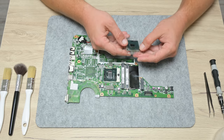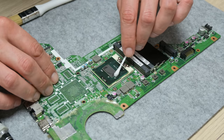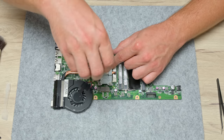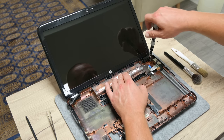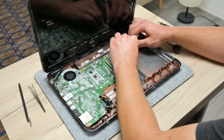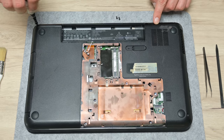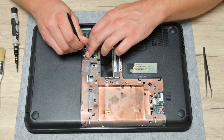Before assembling, I upgrade the CPU first. I clean the new CPU from old thermal paste using a little isopropyl alcohol and brushing. The safe way to clean the CPU is while it's in the socket, because the pins are protected there. The new CPU is an Intel i7-2670QM — a Sandy Bridge processor, much better than the previous Pentium B960. Almost any laptop from this generation will support upgrades, except those with the HM70 chipset. These processors were released back in 2011 and are getting old, but this CPU is still much better than using the old one.